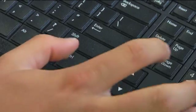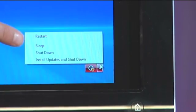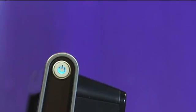If you've tried those things and it's still not working — your computer is still frozen, crashed, not responding, and you can't even turn it off — first try pressing and holding Control-Alt-Delete. That takes you to a new page where on the right-hand side there's an up arrow; click that and select Restart. If that doesn't work, press and hold the Power button until the computer turns all the way off. Let it stay off for a couple of minutes to discharge, then turn it back on.